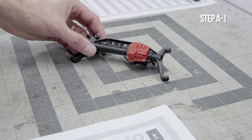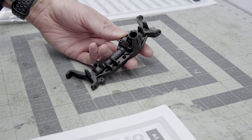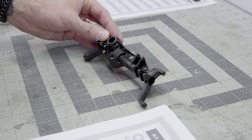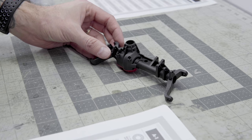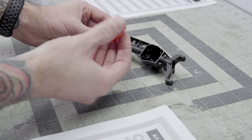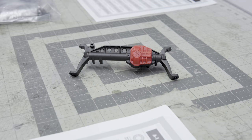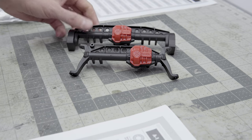These are the new AR-45 portal axles. They are a one-piece design, double shear for both shocks and links, and use the standard ring and pinion that we're used to. New diff covers though, so old ones won't fit. That's the rear portal as well — also a one-piece design, but heavily trussed. Lots of support built into these axles, same with the front. You can see there's a ton of support on the top of the shafts there.